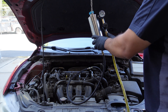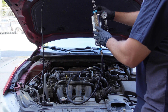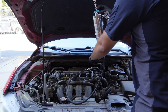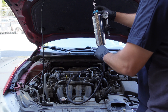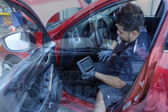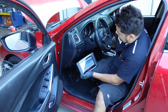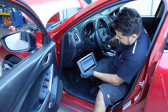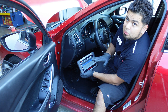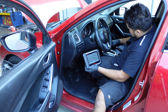So what you do from here is disconnect your airline. What you want to do is relieve the pressure here, just so in case there's any fuel left, it won't make a mess. Once you get the pressure all the way out, now you can disconnect this line. You're going to hear it cycle, then turn it off again, then turn it on again — just so we can purge it. It might have a little bit of a struggle turning on. Now exit this screen and we're going to start it up.